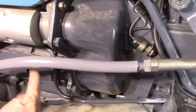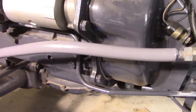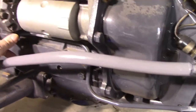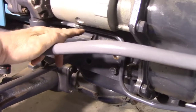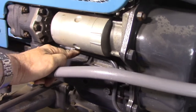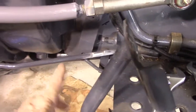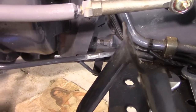That's the main point. I'm a little worried about doing this job — I've done a bit of plumbing before, just household plumbing, never done anything with hydraulics. I'm going to start by taking this piece off the oil pump so I can hopefully pull the pipe out enough to get a cut in there. I can put the rubber hose on this end with a pressure fitting, then put it back on and come down to the other end, cut it off about there, join the other end of the rubber hose on — hopefully a nice straightforward job taking only a few minutes. Famous last words.